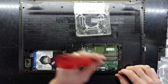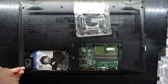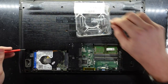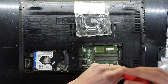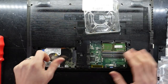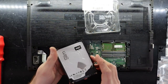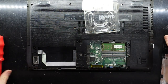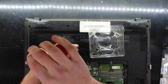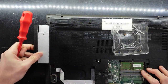I'm gonna put these screws in a different spot just so I don't get mixed up. There are only three screws in this location. Next up we'll take the hard drive out simply by pulling that way and then up — and we're out. Put that off to the side and keep going. Next up will be the DVD burner — take this screw out and then slide this forward, bingo.